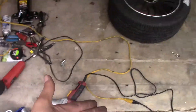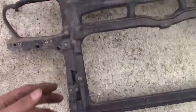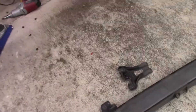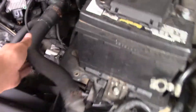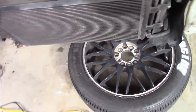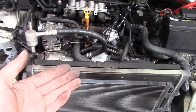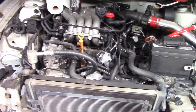Here we are. It's really simple — just remove all the screws you see and it comes out. The ones that held the radiator — I removed all of them, but something was still holding it: these screws on each side. Now that those screws are done, it just slides right out. That hangs there, but I have that tire there which is just hanging from the hoses. I need to figure out how to take this AC condenser out.